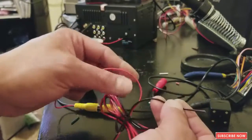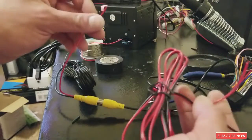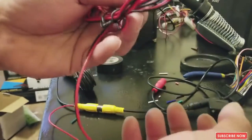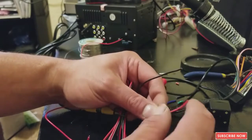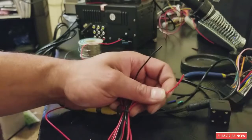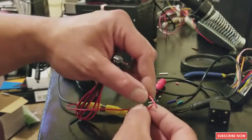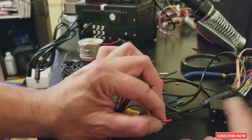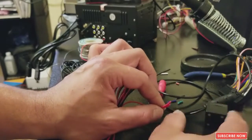I'm gonna show you this in the car, but I'm just gonna explain it really quick. So you gotta find a negative on your car, and the positive, this positive right here, is gonna be connected to your tail light. Remember, every time that you put the reverse on your car, the light on the tail light turns on, meaning that the tail light is gonna give a 12-volt source to this cable. These two are gonna be connected, and then you're gonna find a long cable to connect it to positive on your tail light. Okay, so that will power on the backup camera.